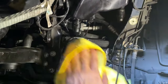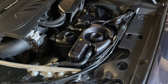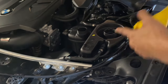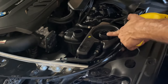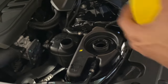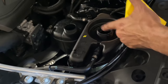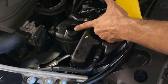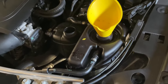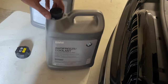Don't forget to clean up the mess you just made. If you didn't drain the coolant, now take your funnel — this is why I didn't drain my coolant — you just have to refill until you see it on the max line. Start the car, turn the heater on to the low setting, and keep checking until it hits between the max and medium line. Do the same for the little tank. Make sure you get a 50/50 mix of BMW antifreeze coolant.